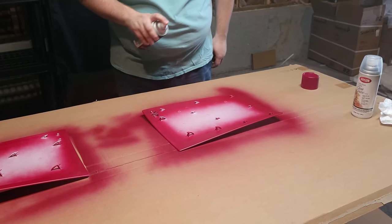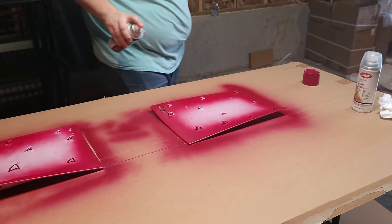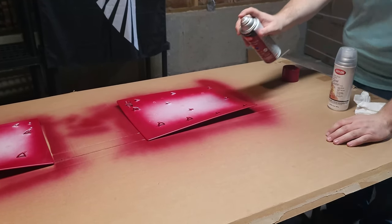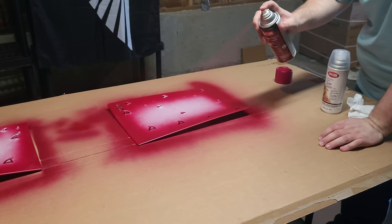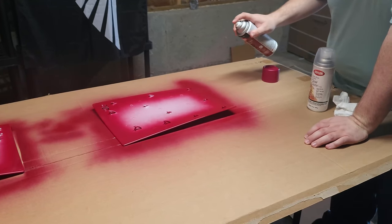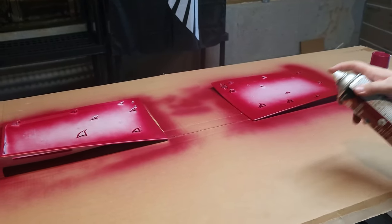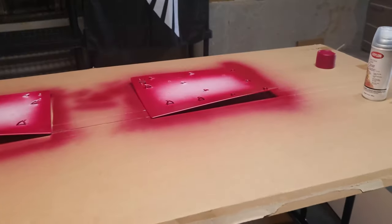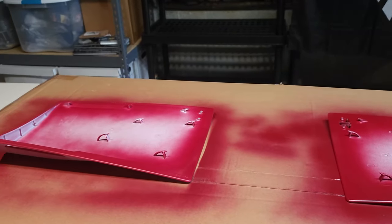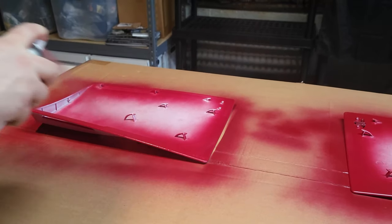Second coat, you can kind of come in lighter with it. I like light coats, especially working with plastics. We need to make sure we're getting in that emblem all right, but not enough to make it bleed through to that other side. This is looking beautiful. Light coats. If you ask me, would I rather have 3 thick coats or 1,000 thin coats of paint? If it's me, I'm going to go 1,000 every time. Now, is that overboard? Yeah.